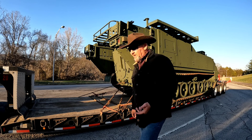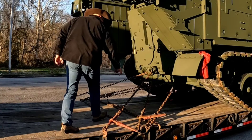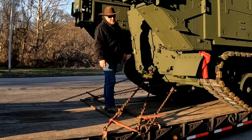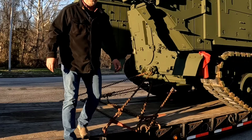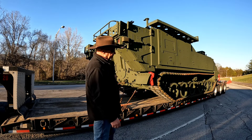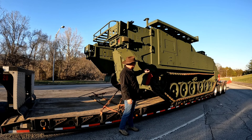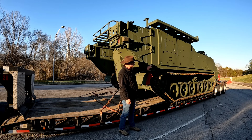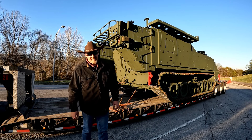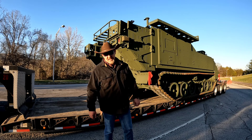For securement, knowing that it's 64,000 pounds, we got three chains back here. We get credit for all three of them because they go all the way across. This one starts here, attaches to this side of the trailer, goes through, comes to the other side, and X's. Even though it's X'd, it's going all the way across so we get full credit for it. We've got the two X'd and then one going through the hitch — that gives us three full chains credit back here at 6,500 pounds each. And obviously you've got to have the markers on the widest portion. Interestingly, none of this body is metal — the magnet doesn't stick to anything except this bracket right here for the mud flap. So we got our signs and flags on the widest portion of load, and signs on the front and back of the load.